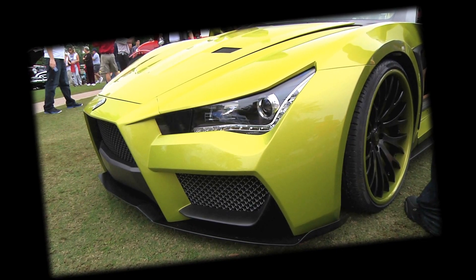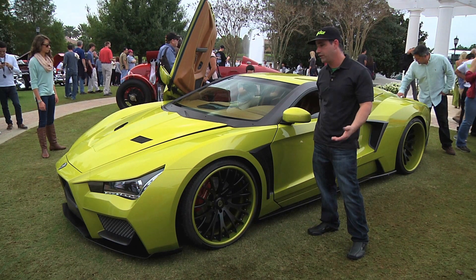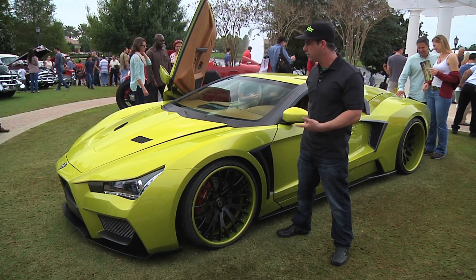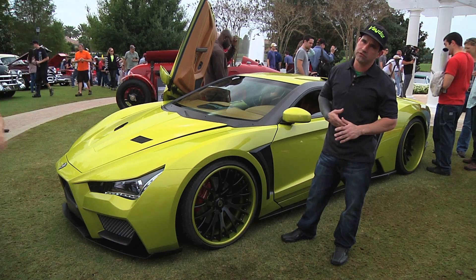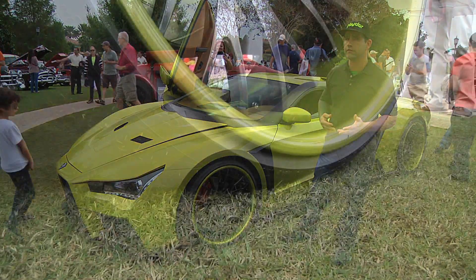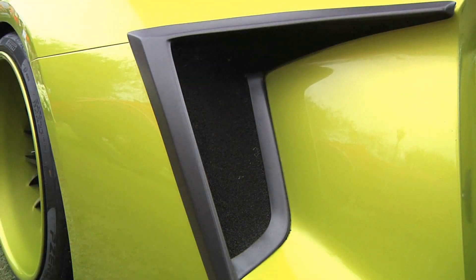They gave me kind of a sample, I said that's what I want, why don't you put it in my car. So that's basically all the electric here. It's a 46-kilowatt lithium-ion pack, and it's a twin 9-inch motor setup. We're looking at about a hundred miles range for three hours of charge, so it's pretty decent for a conversion. With the electric in front and all the batteries in the rear, you have pretty good weight distribution — it's pretty even.